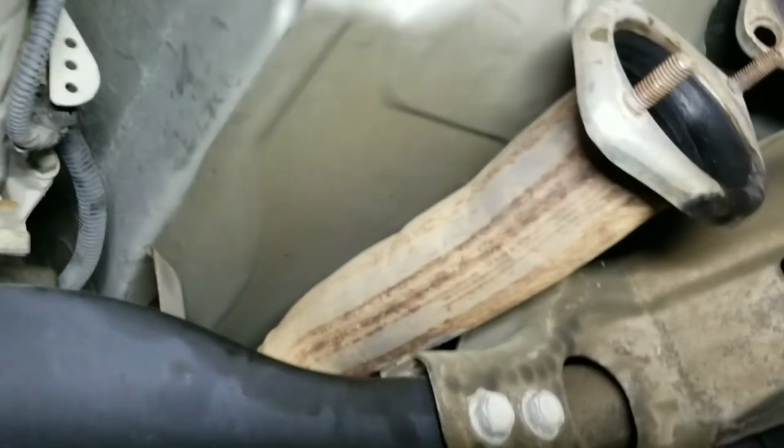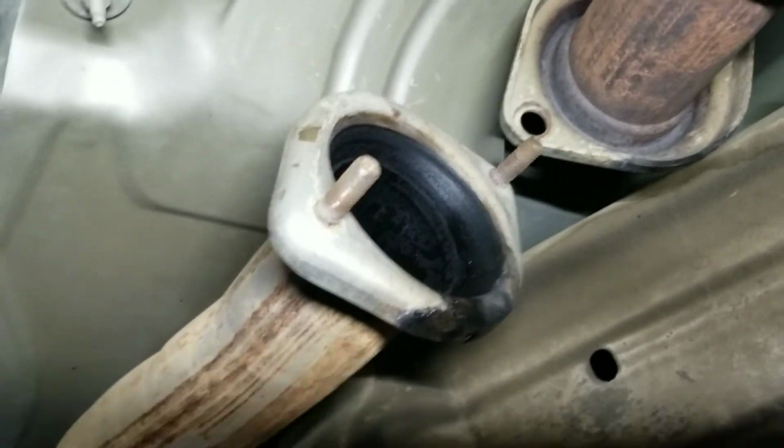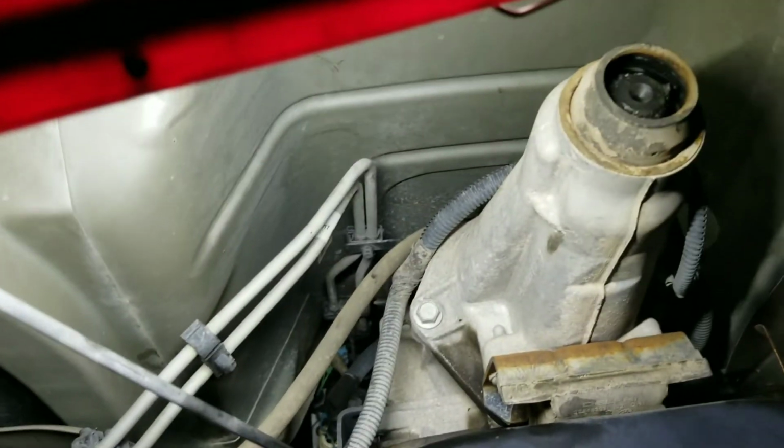So let me go ahead and do it so I can get the cable off. Now also I removed this exhaust, the 15 millimeter nuts. Took that off. That one is going to connect over the 2. This is gonna be one full piece. So we can remove the transmission linkage or cable from there. Removing the clip. So let me go ahead and get a flat screwdriver. Let me start getting it off.